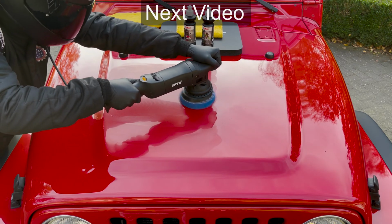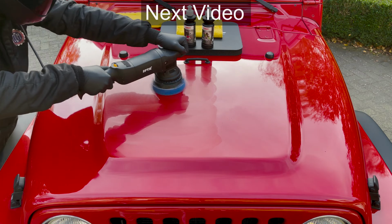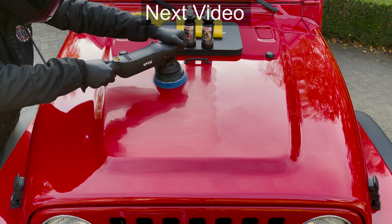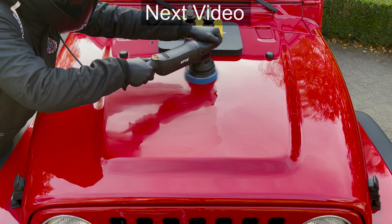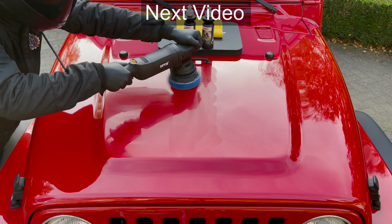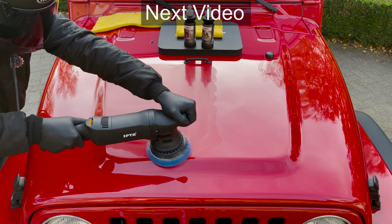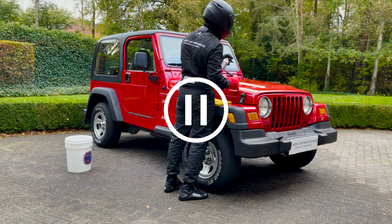We'll address that in our next video. But when you polish your car, you're going to remove a few microns of paint thickness in the process. That's what polishing does. No big deal for healthy car paint, but this is a major thing to consider if your car paint is old and worn because you want to avoid rubbing or polishing through your car paint, right? Because if you do, you'll be looking at thousands in respray cost.